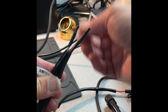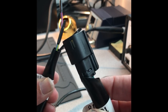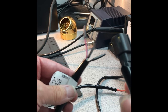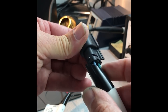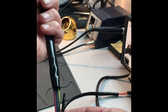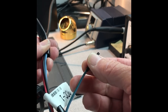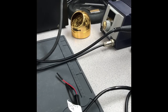Accessory two gets direct battery power if you need that for something, plus the ground and the direct switch lead — so that's limited to two amps. The middle position switch lead is obviously connected because there are four wires here including the green one. If you pull this off, it's under here — right there is our green lead for the left switch bank on the fairing middle switch position, so you know where that is if you want to use it.